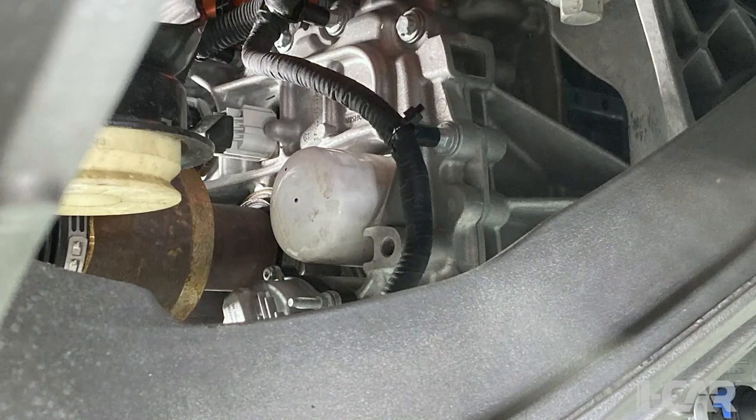I would think it would make some pretty substantial damage to drive it that far, but hey, you never know in a collision what's going to happen. So there's a filter assembly, and they do have a decal on the differential that identifies the Mercon fluid that belongs in this, if for some reason that needs to be serviced. Yes, that's going to help clean up any of the stuff that's inside there, and that works in conjunction with that plate cooler to help cool the system down.